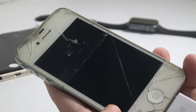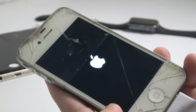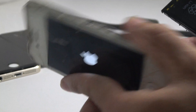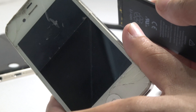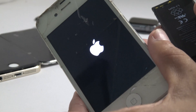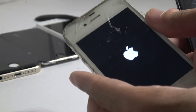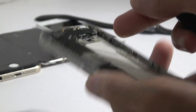So if everything else fails and the boot loop still happens and you have an older device, that means it's the battery — you might have to replace the battery. That battery there is 100% dead and it does not charge or register with the phone. There's no way I could fake that, so there it is — replace the battery. All those guys on YouTube with millions of views saying you could hold your volume up button to fix it — they're just full of crap, it doesn't work. The volume button doesn't do anything for an iPhone 4 except turn the volume up.